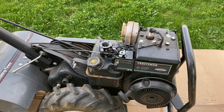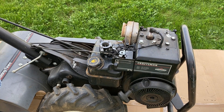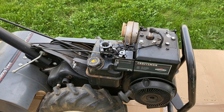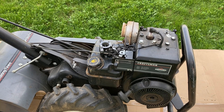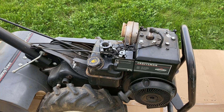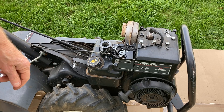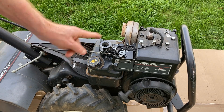As you can see, we don't have any pulsing now. I'll get the air cleaner and everything back on. You can change out a carburetor if you like — I'll put a link for that carburetor down below too. This is a Briggs and Stratton horizontal shaft motor, and this is the type of carburetor that mounts right to the top of the gas tank. But I would not do that if I were you — I would rebuild it with a new diaphragm, take out the needle valve, clean it, and I think you'll be happier with the original. If this kind of content helps you, please subscribe to the channel and give me a thumbs up, and I'll see you on the next video.